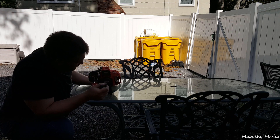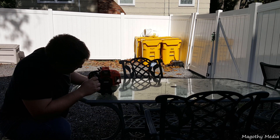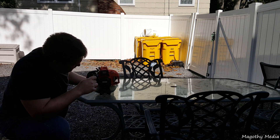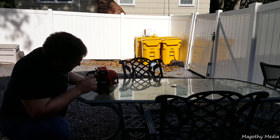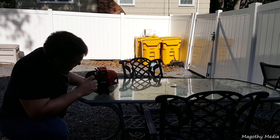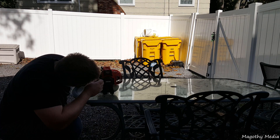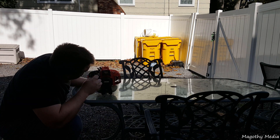The reason why these are blanked off is for two reasons: one, EPA restrictions, and two, the manufacturer doesn't necessarily want you leaning out the equipment and burning it up. So after you get it running ideal like this, depending on the attachment you're running — because this is like the ECHO version of the combi system — you're going to want to run your attachment with it in that load situation. You are probably going to have to tune it slightly; if anything, you'll probably end up enriching it just a little bit more. It's something you're going to have to feel out and get adjusted to best suit your needs.